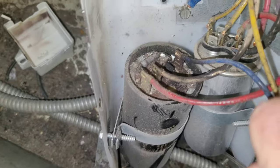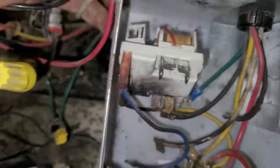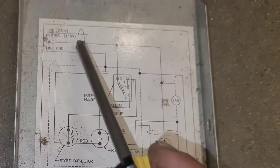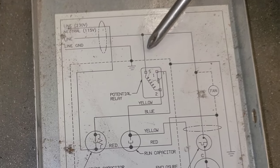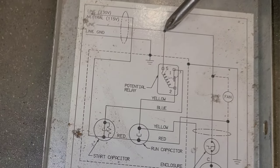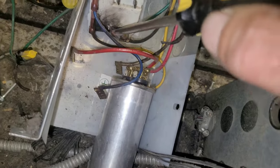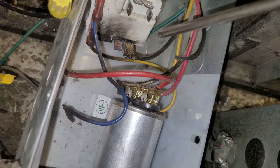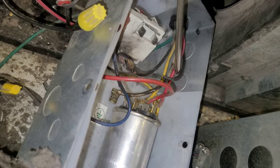I'm not going to listen to that guy. I'm going to do it my way because I think he's wrong. The whole problem with this here, and the reason that this happens — this is the schematic, and this right here is the circuit in question. You see how the schematic shows it going to five, one wire coming off of five and teeing into it right here? So that would be like a wire nut, right? Instead, at the factory, they bring in the line right here on this wire and they piggyback on it, and they rely on these spade connections to last and be okay. But what happens is they get loose, they get hot, they get loose, and then it results in this damage right here.